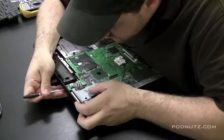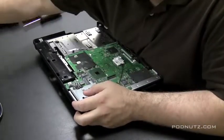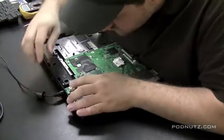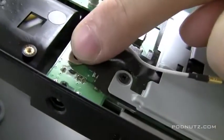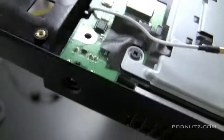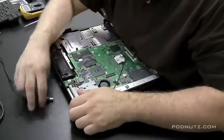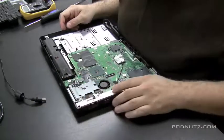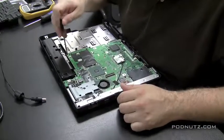I'm putting a screwdriver in the power jack hole to shake the pin around. The pin inside the power jack may be loosely attached to the motherboard — that's why you're not getting a connection. Note: the power adapter cord is not plugged into the wall right now. You can see that the center pin is pointing in a different direction and is loose from the motherboard, not making a proper connection. We're going to have to re-solder that point. When you jiggle the power adapter you can see that pin move up and down — that's what we're fixing.